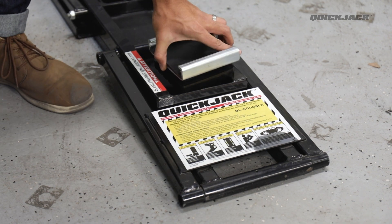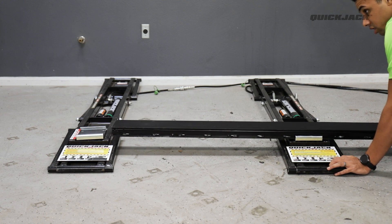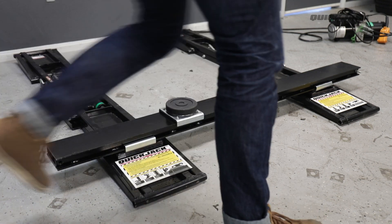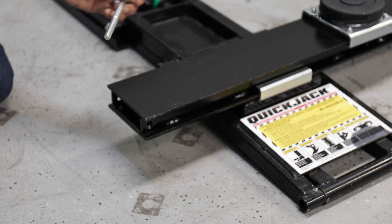First, I'm going to place the bases into the tray on the side with the narrow lift points, and then slide the adapter in. Hold down the frame with one hand to keep it from shifting. Next, you're going to slide the lift pads — these pads are what you'll adjust to hit the lift points. Then secure with the provided nut, bolt, and washer.